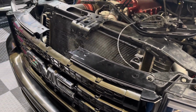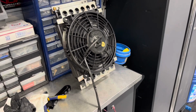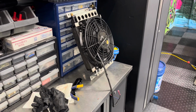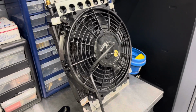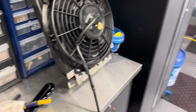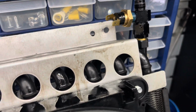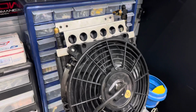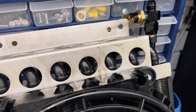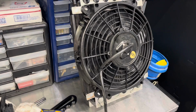You guys ever use this one? Let me know if you had any good reviews with it or bad reviews. I've talked to probably about 5 or 6 different guys, and they all said that they ran 200, sometimes more, with the fan wired onto the ignition. I even had a temperature switch on here to cut it on at 180, shut back off at 165. But this thing would never get below 180 ever. It was actually always around 200, sometimes even 210. But that's where I'm at now.